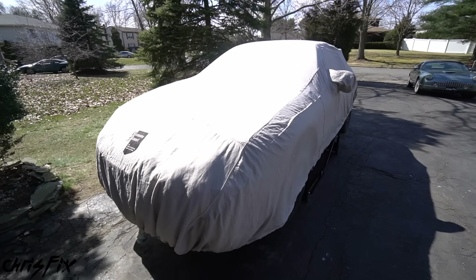Jensen introduces the 1993 Honda Del Sol and gives a quick rundown: the major issue is a blown head gasket — lots of smoke out the tailpipe. The control arm needs replacing and there are a couple of squeaks. Cool features include the removable top and the rear window that rolls down, making it a great summer car. There's a little body work needed in the back, but nothing too serious. He pops the hood for inspection.